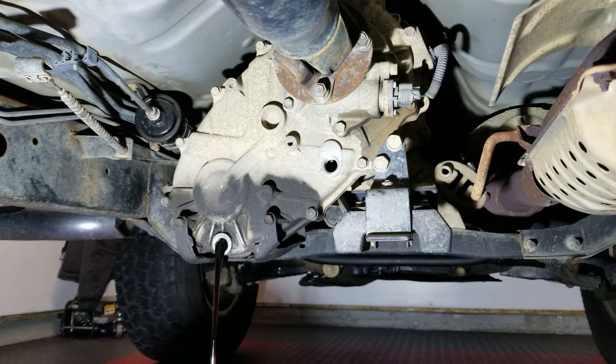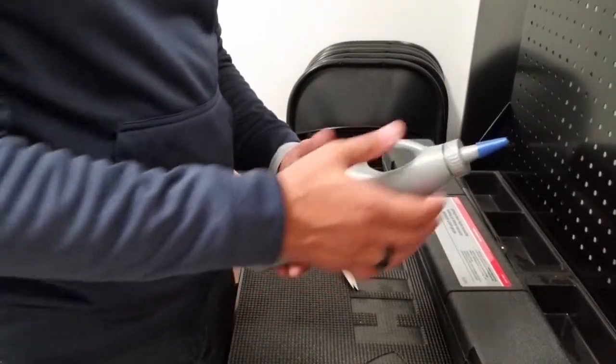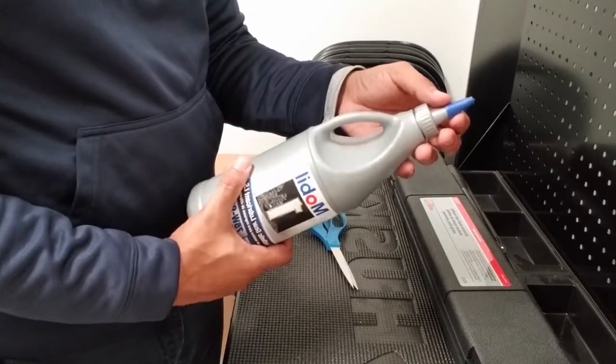My fluid is pretty dark — this hasn't been changed in a while. I'll let it drain for about a couple minutes, five minutes or so. Now as that drains, a quick note: in the description below I give you the exact capacity you'll need for a first gen Tacoma, but you can find that in your owner's manual for a different model. The capacity isn't that important to know because just like a typical transmission case, you just fill the transfer case with oil until it starts to trickle out of the fill plug — not the drain plug, the fill plug. Once it starts to trickle out you know you've reached optimum capacity. I'm using Mobil 1 75W90 gear oil — the brand isn't really important, this is just convenient for me.